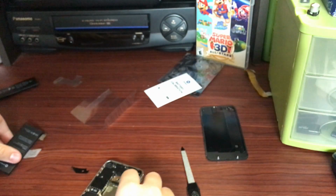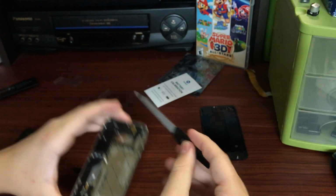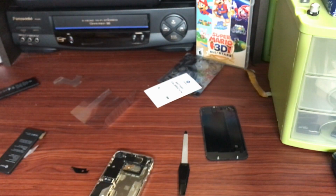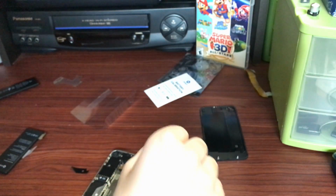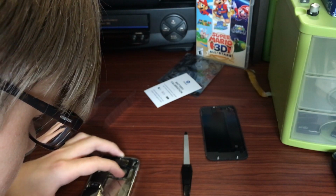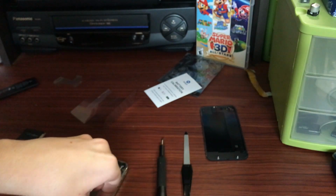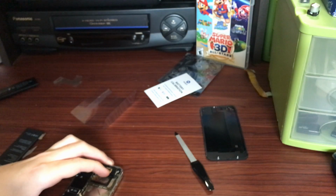I personally don't see much use for the tape or for the adhesive that holds the batteries in place. I would just use screws or a couple of brackets instead of dealing with adhesive, because that's better for right to repair and all that, and it just makes the phone easier to repair in general. You don't have to deal with a risk of accidentally puncturing the battery while having to pry it out, not if but when the stupid tab breaks.